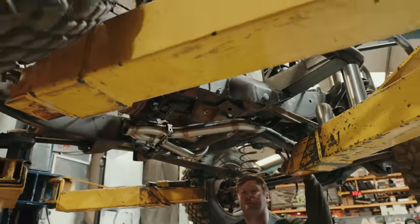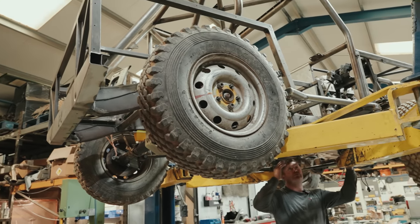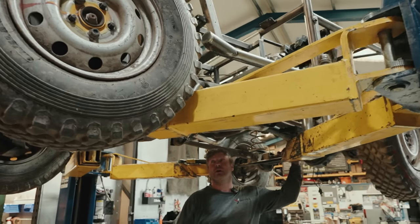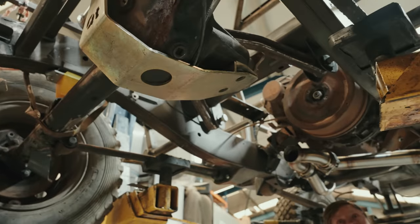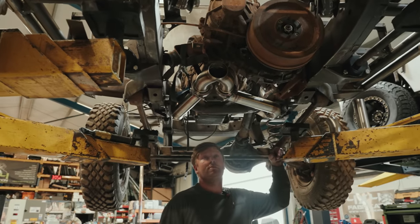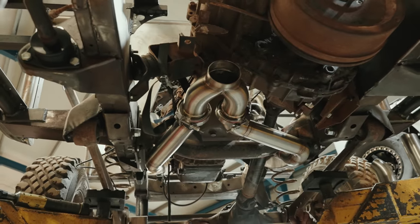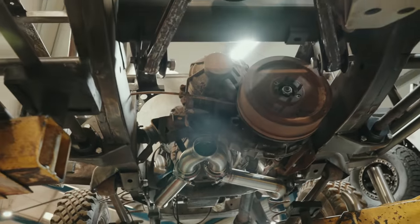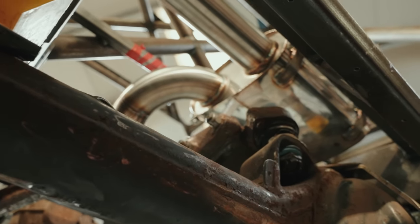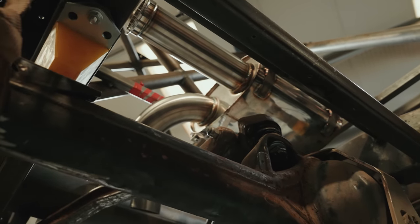What is this that you've been working on today? I'm not sure of the full details, but I think it's two chassis that have been joined together to make a short wheelbase off-roader. It's a Rover V8 engine, and it's coming for the full exhaust system. Just halfway through making that now, really. Obviously 2.5-inch downpipes, as per all the LSs and stuff. And the silencer's hidden up here at the base, saves any knocks and bangs. All 3-inch to the back tail tip.